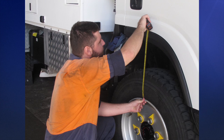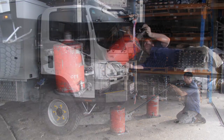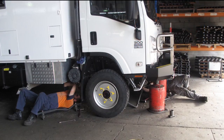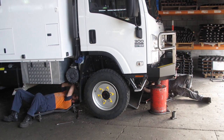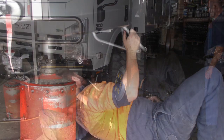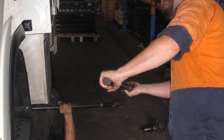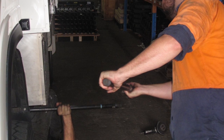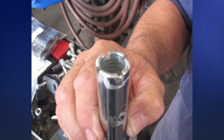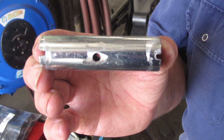Let's take some before measurements for later comparison and get the vehicle ready for front spring replacement. We jack the vehicle up and secure the front on jack stands under the chassis, then remove the right-hand side air box assembly to provide access to the right-hand rear shackle, and off with the front sway bar to make spring removal easy. The standard silent block bushes — comprised of steel-rubber-steel — are removed using a long punch and some gentle persuasion. These will be replaced by urethane bushes with steel tubes. The tubes have been specifically modified to ensure grease can be pumped in effectively to reach all possible squeak points of the bush surface.